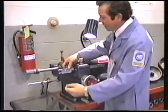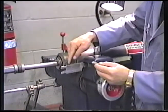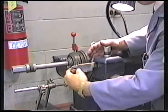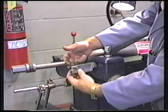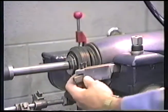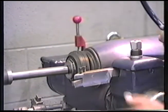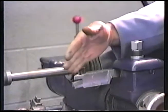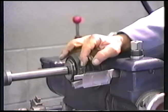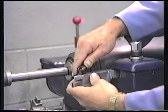We'll put the tool bit in, and the very end of this tool is where the end or the bottom of this screw will rest. We'll slide that in. Hold it firmly in place and lock these screws down. Now, depending on the type of drum that you may be working with, it may be necessary to vary this tool bit slightly sideways, advance it, or retract it. That's what the screws are for. So we'll lock that down and then go on to our next step.